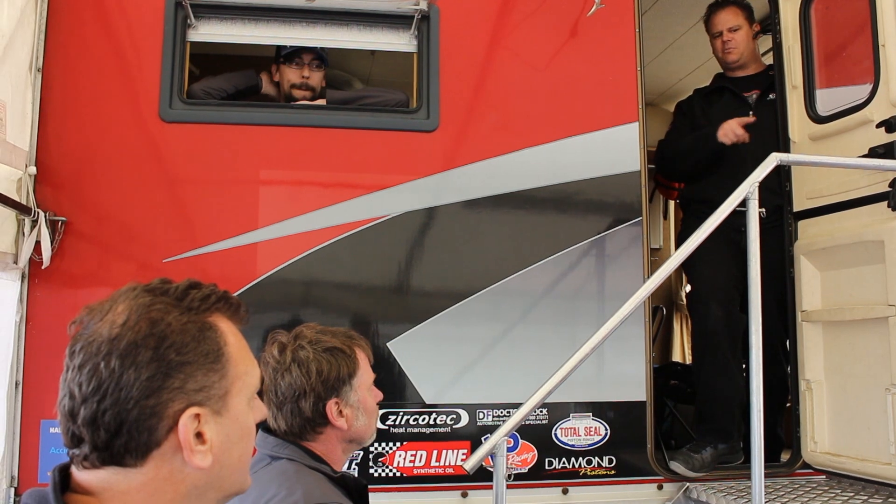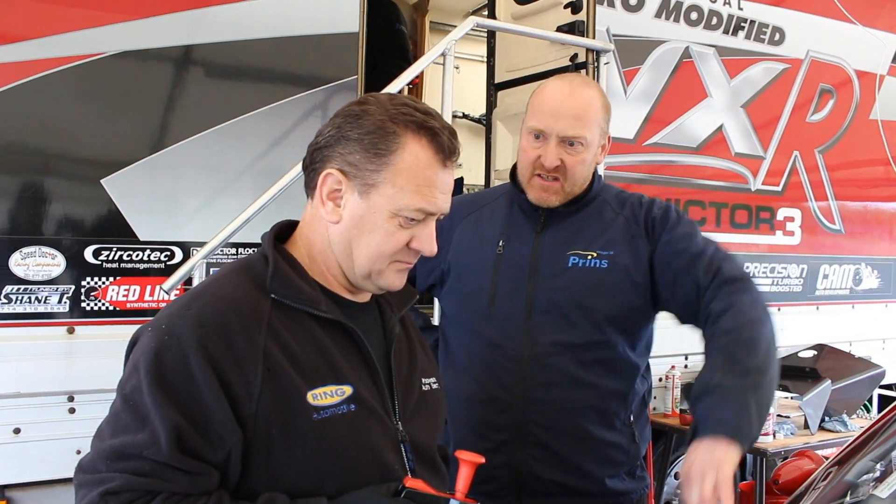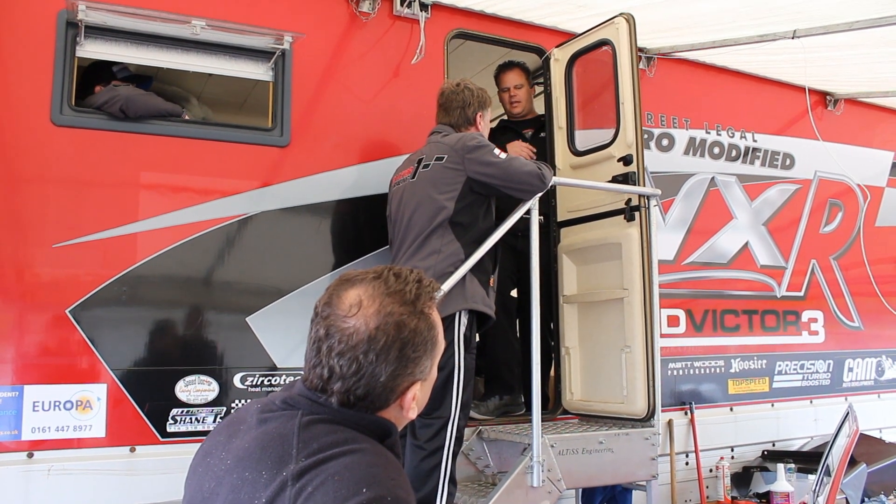After a little back and forth with the guys and some other tests, I eventually decided it must be the engine. But that's a really hard sell, because it's almost never the engine — it's almost never something mechanical that's wrong, it's almost always something electronic. You've got to be a little thick-skinned and stubborn when you've got seven guys telling you no way it's the engine. However, the electronics don't change themselves, they don't wear out, they never decide to do something different than what they're programmed to do. So unless someone's physically moved something, the electronics is going to do the same thing it's done forever.